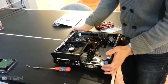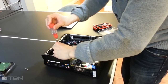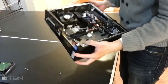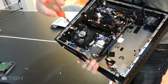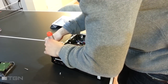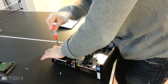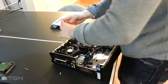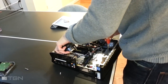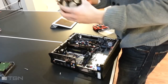Next, I'm going to remove the CPU fan and heat sink. Two screws over here, extremely easy. The shroud lifts right out. There are four screws containing the fan and heat sink. You disconnect it where it connects to the motherboard. And there's the CPU fan and heat sink.